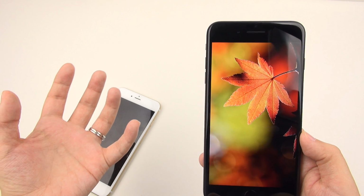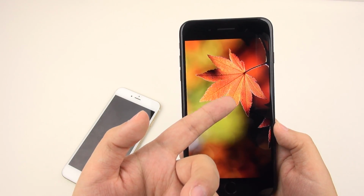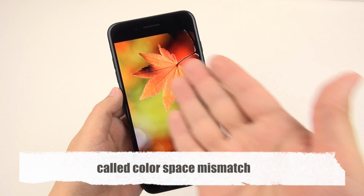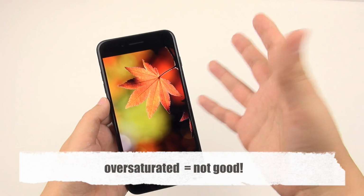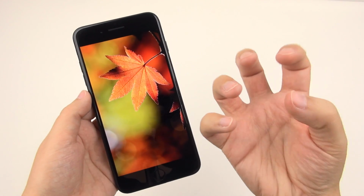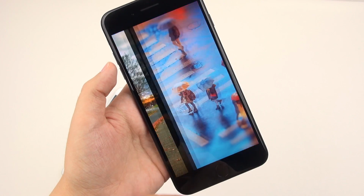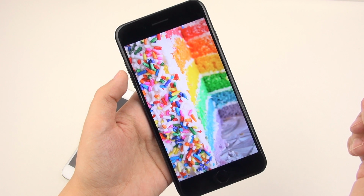But if you have an image that is still sRGB with that smaller range of colors, and you view it on this display, it's going to map it properly. If you don't map it properly, it'll take that smaller color space and just stretch it out to fit the display, and everything will look saturated. When it is mapped properly, it's going to take those colors and put them where they should. So you'll be able to view an sRGB smaller amount of colors on this wider display and it will still look right. I know this is complicated, but all this is to say that images should look right on this display because Apple is being careful in color managing things.